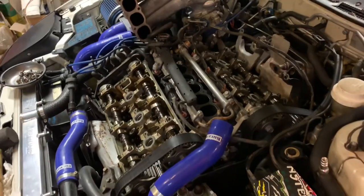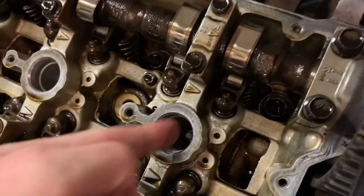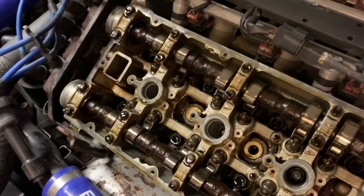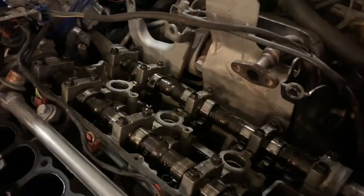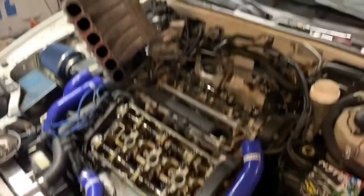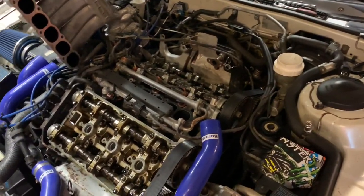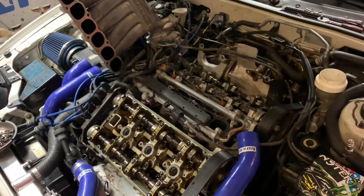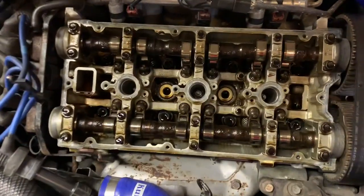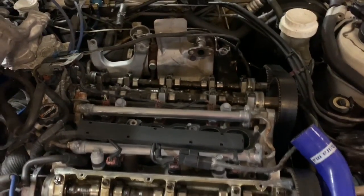It's all apart and I am down to the heads, and I can get to the lash adjusters now. They're right here, and there's about 24 of them. It took me almost exactly 35 minutes to do that, including moving the camera around. If I really just cranked on it I could probably do it in 20 minutes, but I'm out of practice. Time to get my new tool out that I bought with the new lash adjusters and see how that works.